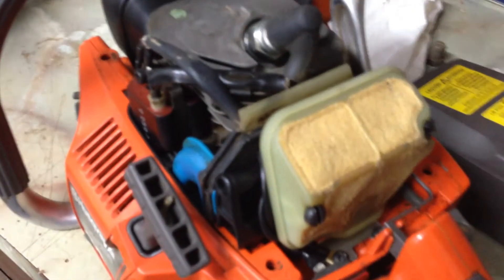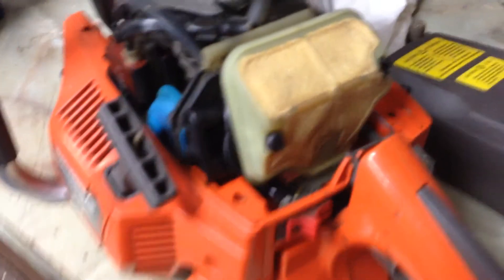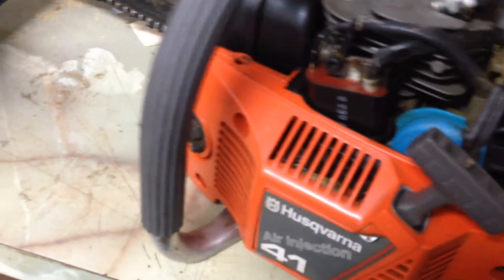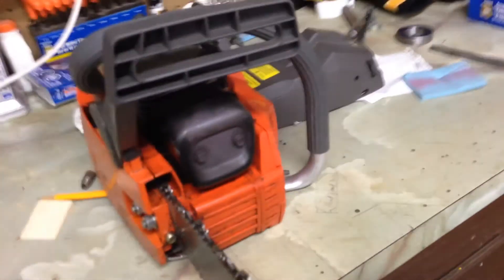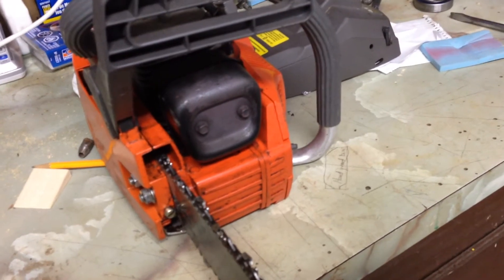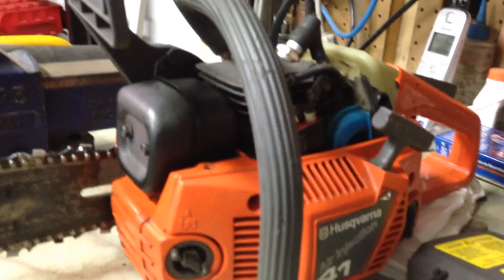This here is your little air filter. It just keeps all the grit out of there so it doesn't go into the carb, into your cylinder, burn up, or cause any damage inside there. A lot of people don't know how to tell if their saw isn't running well, or how to clean it yearly. You're supposed to clean your machines out once at the end of every year - drain your oil out, drain your gas out completely, then take your carb, clean it all out, clean out your lines. You can probably buy new lines and a filter depending on what shape they're in, or you might be able to reuse them.